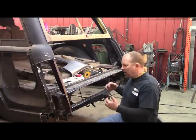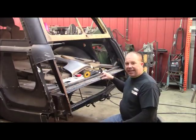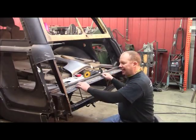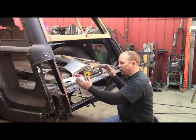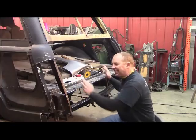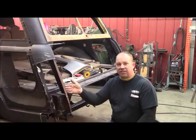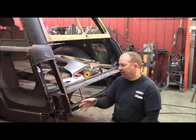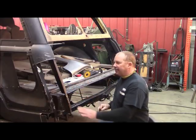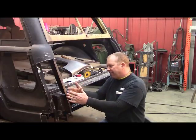I've got the tailgate back off because I went ahead and did all my measurements. I marked this landing in here, and I've cut and fit this landing back to the location of the tailgate with adjustability in it. When I set that, it tells me the distance I've got to have from the face of this to my seal landing to the outer surface of the metal gate in relationship to the wood. I've got all those numbers factored in. I'm about ready to wrap this piece - I've located the height on it and the depth on it.